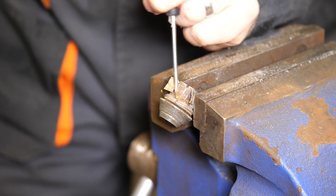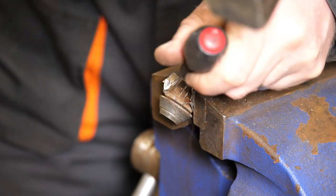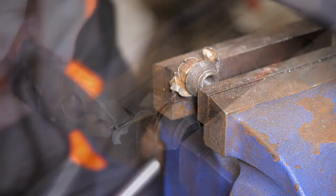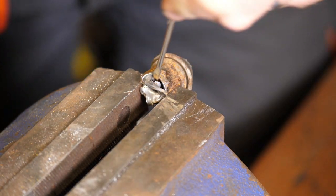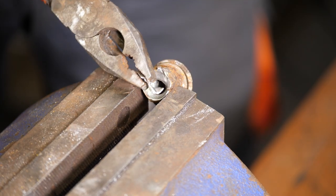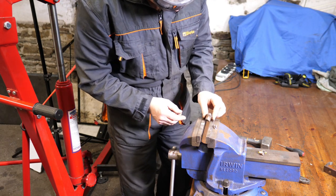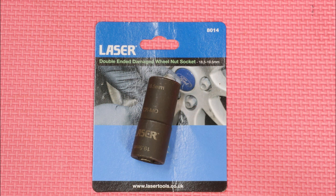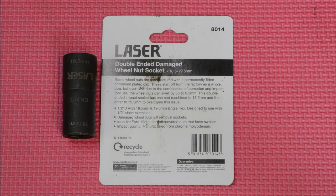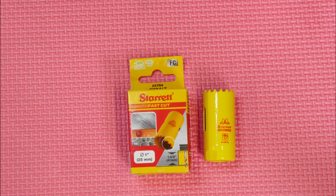In hindsight, I think I would use the Laser tool to remove all the nuts and just order a new set of nuts. Unless you get a hole saw that cuts exactly right and removes the chrome cover cleanly — then you just use an 18 millimeter socket — but I didn't have much luck with that. Here are some reference photographs. If you try a hole saw, you'd probably want to try a 22mm or 23mm rather than 24mm.